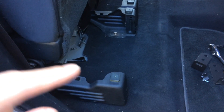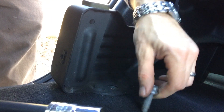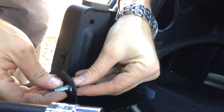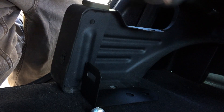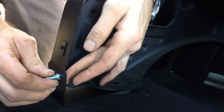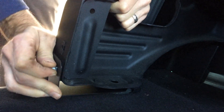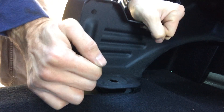We're going to start by looking at the rear seat brackets. We're just going to unbolt these because you're going to need to slide this new bracket underneath — put the carriage bolt in first. It might help if you remove the seat from the back part as well; there's another bolt back there. That'll give you more wiggle room so you can lift this up and slide everything back together. Once you get everything lined up it'll just pop right back down. There we go.